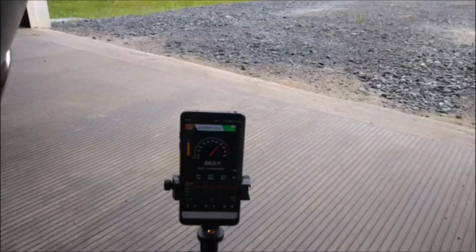So what's interesting here is that the decibel range doesn't really change, but what does change is the note of the exhaust. You see it become more raspy, or you hear a deeper tone, which is interesting. So it's maybe not as much of a volume change as a difference in tone. So once again, this is a stock OEM muffler and center pipe, just different headers that are on there. So you actually see and hear the difference within that.